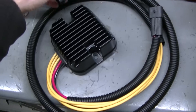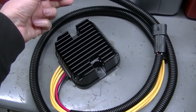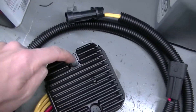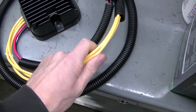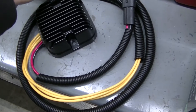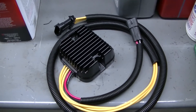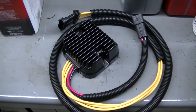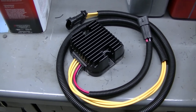It's got a really long wire for some reason - this might be for a Rzr or something, but it said it fits a Ranger so hopefully it fits. You got plugs here that plug in, two bolts to hold it on - you unbolt it, unplug it, and should be able to swap it out that easy. I know the wire is way too long but we'll wrap it around and tie it up. If it works it works. I think it was 60-some bucks. I'll have links in the description for the charging port and this voltage regulator.